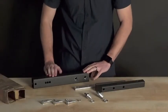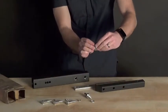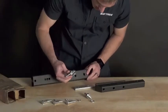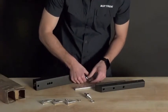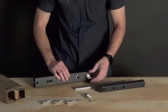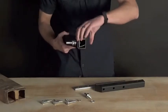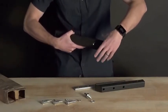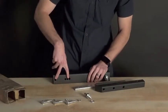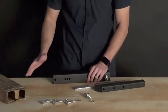Installing this piece into a two inch receiver hitch requires only one bolt. You'll use the five-eighths inch hitch bolt here with the corresponding large lock washer. This will be used to attach the two inch hitch bar inside of the two inch receiver hitch — this inserts into the vehicle and the bolt comes on from the outside. You will utilize the two bolts already on your bicycle rack to secure this hitch bar to the bicycle rack.